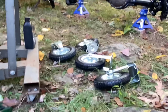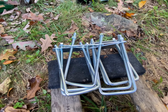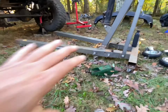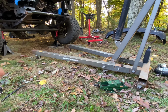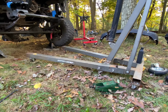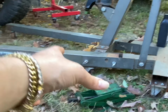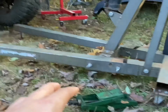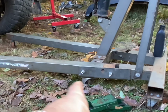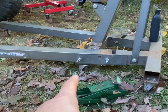So I'm actually gonna go ahead and put these 8-inch pneumatic casters on it with these 3x7-inch U-bolts. So just gonna unbolt these guys, put these on. There's technically 6 wheels on here, so you can't keep the folding functionality with this setup because you have that second set of casters here in the middle, but those arms fold up. So in order to put the pneumatic caster on the engine lift with the U-bolts, it's gonna wrap around and you need that area to swing up. So with these on, you wouldn't be able to fold it up unless you welded it on.